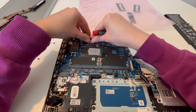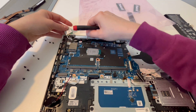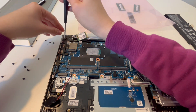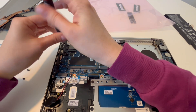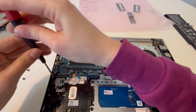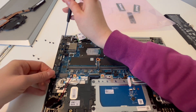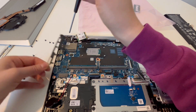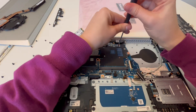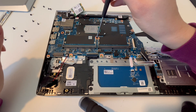So these other components here, I'm going to remove. Now I'm going to remove this little strip. You want to remove all these layers carefully, and make sure you don't miss anything. If you feel any sort of resistance when pulling off a component, instead of pulling harder, resist that urge. Examine why it's not coming off — it is a slow process. Also, if you're worried about forgetting how to put this all back together, record yourself doing it. HP does have manuals for some of their models that show you how to take them apart piece by piece, so keep that in mind.